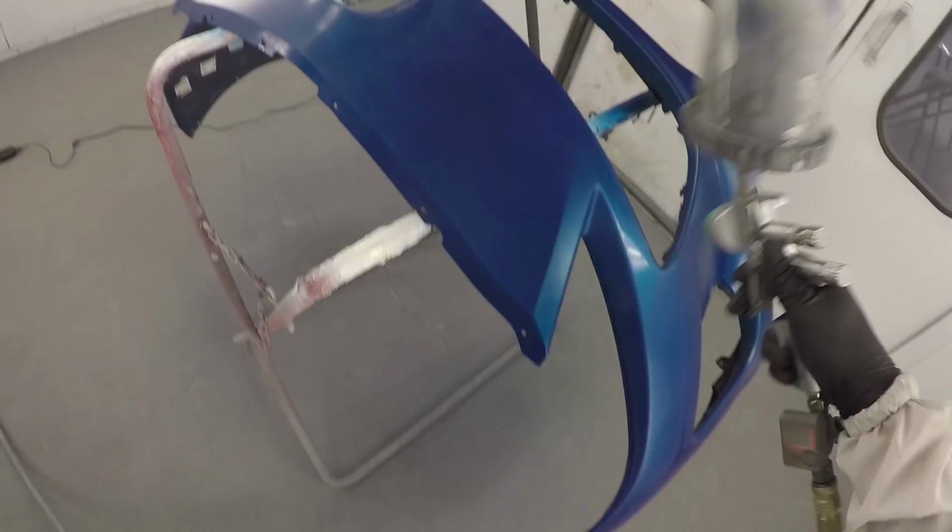You can see I'm dusting both sides there. So right there, I did bring my color over a bit. It just kind of gives it the reason for that. It's just so we have the same effect going on in case there is a slight color difference. If you look at it from one angle on either side, it's going to look the same way. So that's why I dusted on a bit of color there.